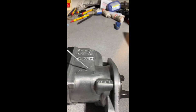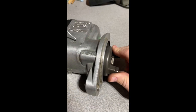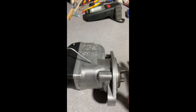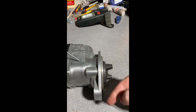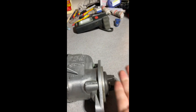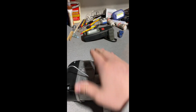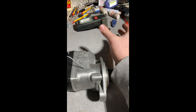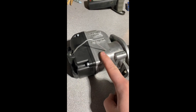To explain it a little without actually putting it on the tractor: once this one sparks you know the lugs were set like this, so you put it on the tractor, mount it with the flywheel at left-hand impulse, turn it all the way to the right, then turn the flywheel over again to the left-hand impulse — so you wind this almost a full 360. Then you turn the magneto counterclockwise until you hear that impulse trip, and that is what they call standard timing. From there you can advance or retard it however you want. I just thought that might be helpful to anybody who's never seen that before.